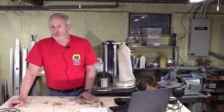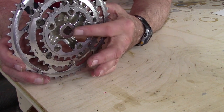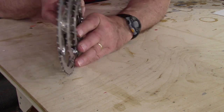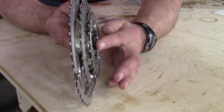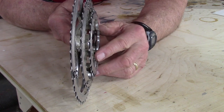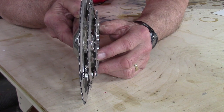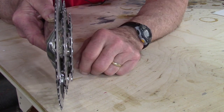I found an issue I had to deal with on the new crankset. On the old crank, the hub was inset a lot farther than it was on the new crank. That means the entire assembly was going to move outboard by the difference between where the old hub was and where the new one is. So I needed to figure out that distance, because I needed to shorten the axle on my bottom bracket by that amount — moving the assembly outboard would move my chainrings beyond the operating range of my front derailleur.